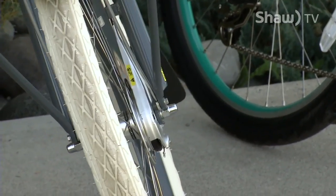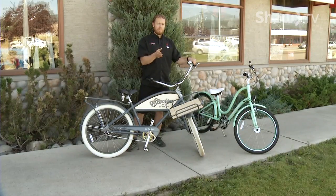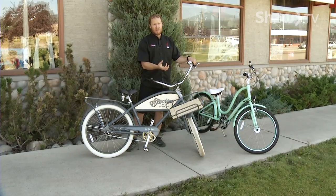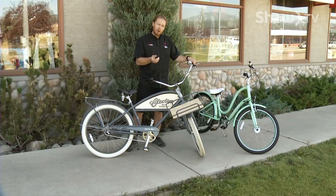One more thing to point out is the front tire. The tires on these are called balloon tires — quite wide but they don't have very much tread. The benefit to that design is that it goes down pavement quite smoothly and efficiently, yet when you take it off-road on light duty gravel or a simple trail around a lake, it gives you the ability to corner the bike and it handles that terrain. Also, due to the fact that the bike has no suspension — no suspension forks in the front or rear — those big tires allow for some cushioning. You run a little bit lower tire pressure than average because the tires essentially become a little bit of your suspension. That's a little overview on cruiser bikes. Thanks for watching; this has been Mike Steven.